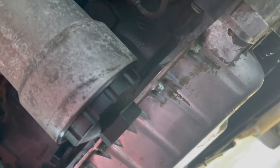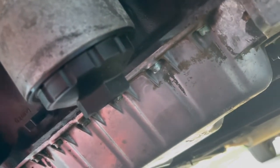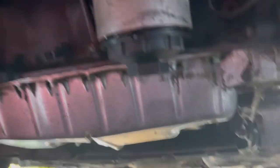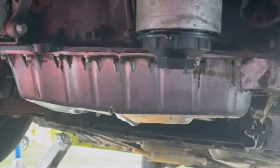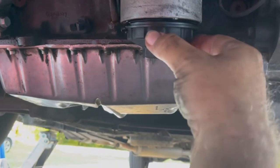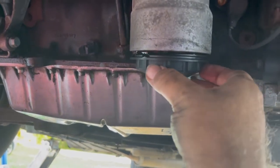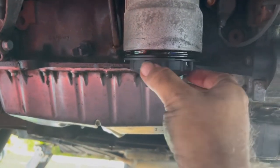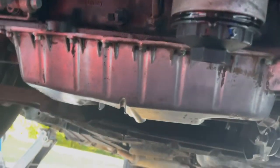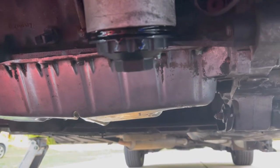To take off the oil filter, you can use an adjustable wrench. If you don't have one that's large enough, you're gonna need a 36-millimeter socket to get that off — and if you've got air-cooled Volkswagens you probably already have a 36-millimeter socket. These oil changes can be quite messy, so I would recommend slowly loosening this and just letting it start dripping so that you don't have a giant rush of oil coming out. Of course, if you want the Niagara Falls of oil, have at it.